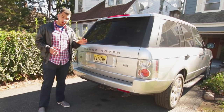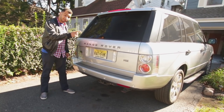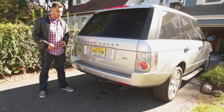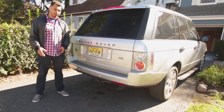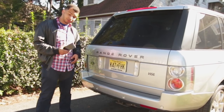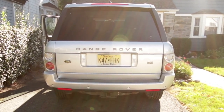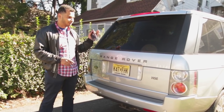The next thing you want to do is make sure all your lights work. This is a simple and basic step, but a lot of people don't do it — they don't actually know if their brake lights, headlights, or clearance lights aren't working. Some cars have notifications that tell you, but a lot of cars don't. What I do is employ the use of a friend or spouse who can tell you if the lights are working. But if you're a hermit with no friends at all, you can use your cell phone — use the camera function, put it on something behind your car, and record yourself pressing the brake, doing the turn signals, and turning on your clearance lights. That will give you a really good idea of whether you need to replace any bulbs.